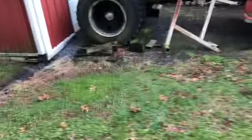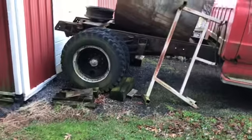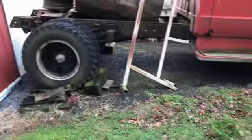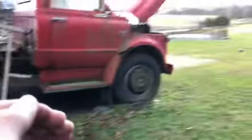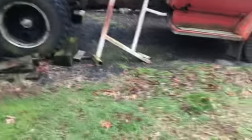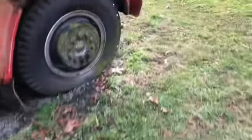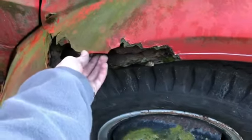Me and my dad talked about this: without brakes you can't stop, can't get it licensed or inspected. What we thought about — and we don't know if it's even possible — is taking a wrecked Ford F550, which has a pretty big rear axle and a decent front axle, and swapping both axles under this truck. You'd have to do a lot of measuring to see what fits best, but then you'd hook it all up and you'd have good brakes and be able to drive it. It would be a lot of work though.